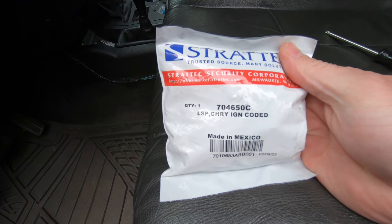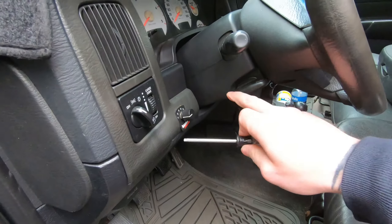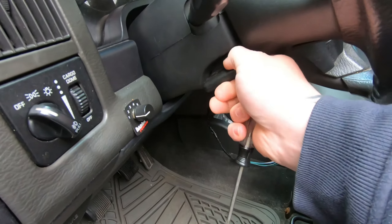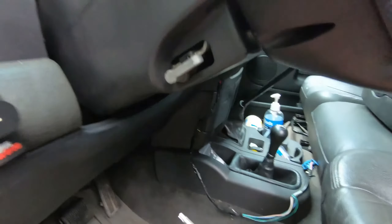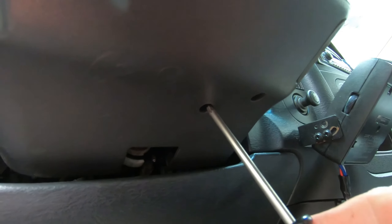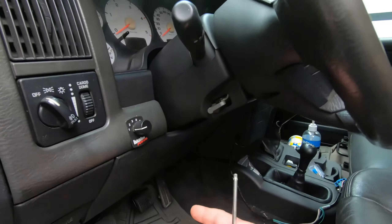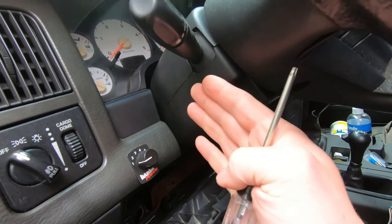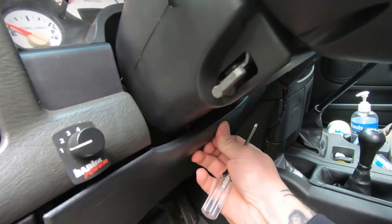This is the set I got — there's a part number on it. First, I'm going to remove the shroud. It's a T20 Torx — pull it back towards the wheel and it comes off. Then you'll have one screw there, one screw here, and another screw in there. Once those are off, the shroud separates. Drop the bottom down, pull it off, and slide it off.